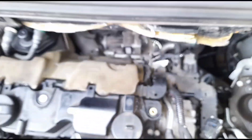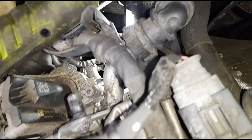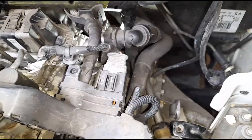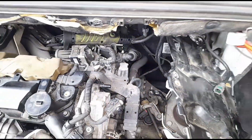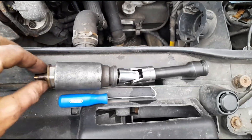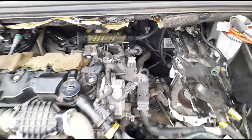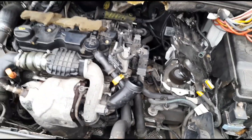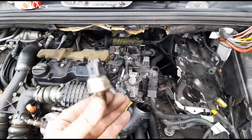It is impossible to see it — the furthest I can get my head in is here, otherwise I'm hitting the bulkhead. I can put my hand around there but you can't physically see it — you can feel it if you've got really fiddly hands and can get your hand completely in there. I've used a very deep 27mm socket on a wobbly to get in there and get that sensor out without dismantling anything. I've done that job a few times. This vehicle is probably a little more difficult than others — a Volvo V60 with this engine has a lot more room down the back — but there we are, we got it out.